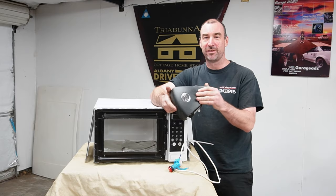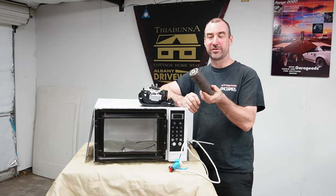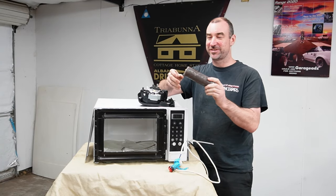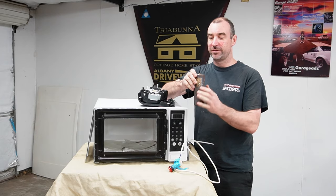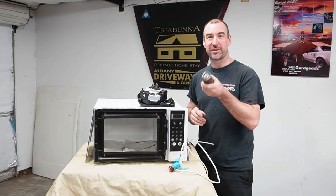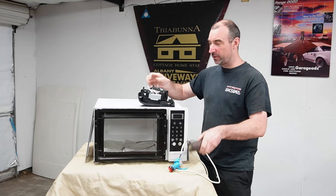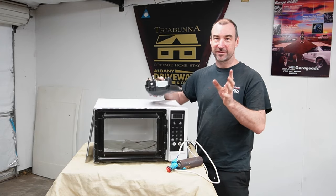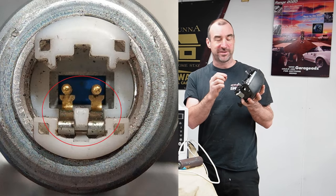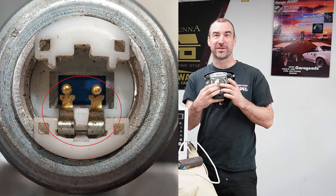So we were hoping that one of these would go off. That was the entire plan. But instead, one of these gas cartridges went off. So this gas cartridge has a lot of stuff ringing around inside it now. The reason this gas cartridge went off, and not this one, was because this gas cartridge had a plug in it. So it activates a squib. And what the squib does, it's not a game on Netflix. It's a little connector that decouples a grounding strap inside this inflator itself.